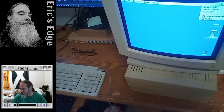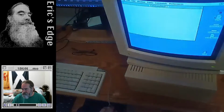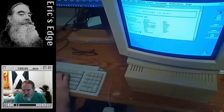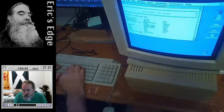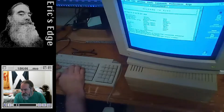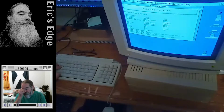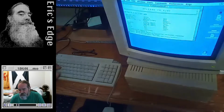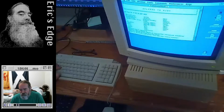So, command shell. And let's see, said to run. Now I got to find it again. Open the command prompt and type new config without the quotes. New config. Making a backup copy, preparing to build new kernel. Oh, so this is forcing the kernel rebuild for new hardware. This may take several minutes. Okay. You'll be prompted for the hostname, IP address, net mask, and other networking parameters. Sweet.